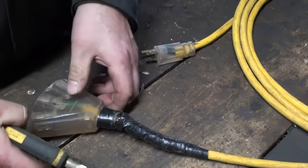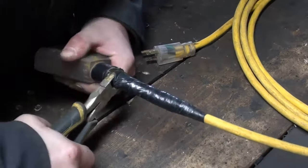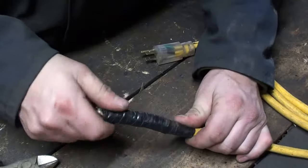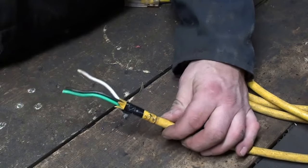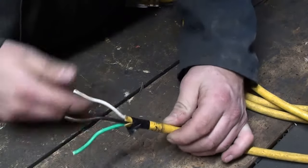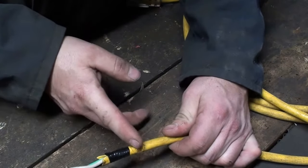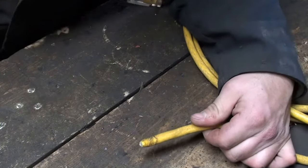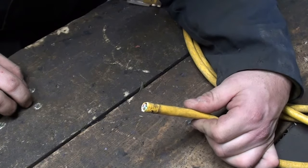So I'm going to go ahead and cut this cord off — this is where side cutters come in handy. And I'm going to remove all this electrical tape. I've got most of the tape off and I've got the wires exposed. If there's any sort of plastic protective damage, you're going to want to cut the wire back past that just to get fresh, good wire. That simulates if you've got just a break in the cord — you're going to have something like this.